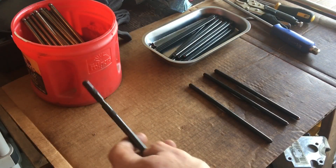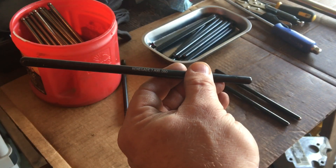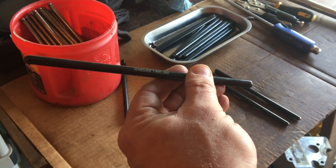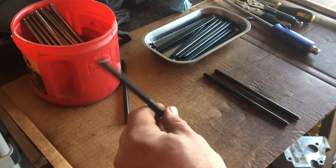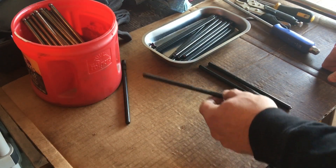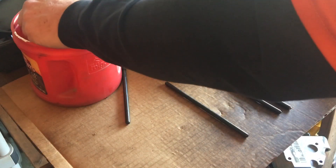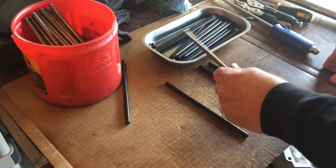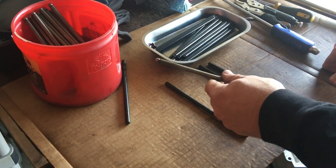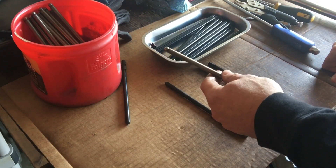Here's some interesting information I've found during this process. These are 7400, 80 thousandths wall, one-piece push rods. Everyone refers to the stock LS push rod as being a 7400, but I read online that the stock LS push rods were actually 7.385 from the factory.